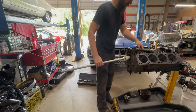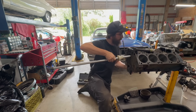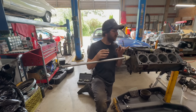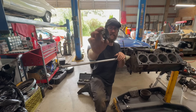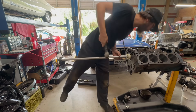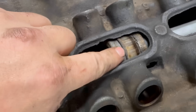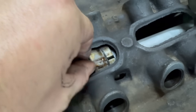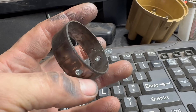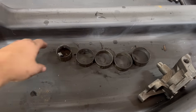There's one out. To get it off the tool, I've got to come in here and hold this hex and spin the handle. Incidentally, all five cam bearings are a slightly different size. The back one in particular is small, so we'll have to switch collets for that one for sure. That one's not pretty, but it's definitely not the worst. This is pretty cool — that is the inner layer of the bearing, and that is the rest of it. They separated when I was driving it out. Here's cam bearing number four — this is the worst one. It has almost no inner layer left. You can actually see right here the seam where this thing is folded into itself. The horrible little bearings are out.